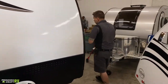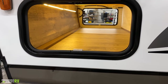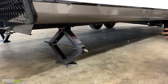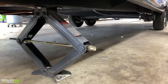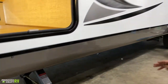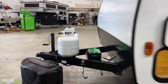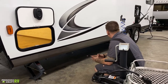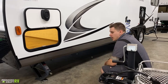Coming around to the side, we have your storage compartment — it is a large pass-through storage compartment. Down low, we have stabilizer jacks on all four corners of the unit. Those are for stabilization, not for leveling. On the inside we'll find a crank handle that slips over top of the drive nut. Once we are level, we run those down to stabilize the floor and keep you from feeling the suspension. Leveling front to back is done with the tongue jack up front. Leveling left to right is done with the tires and a leveling kit. Once you're level, go ahead and run down those stabilizer jacks.